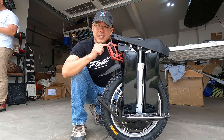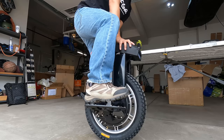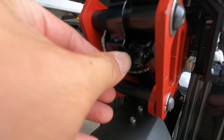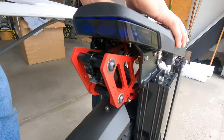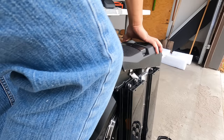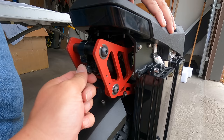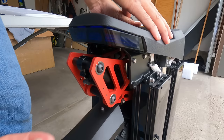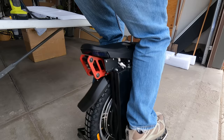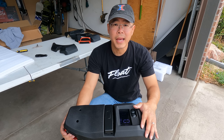We finally got air into the chamber and filled it up to 250 PSI. We've been playing around with the dampening and rebound control — the closer it is, the slower the rebound. When it's on slow rebound and you go to bounce on it, it won't even come back up; it just sits low like a non-suspension wheel. When you release it, it actually rises back up. On the highest rebound setting it just bottoms out easily.